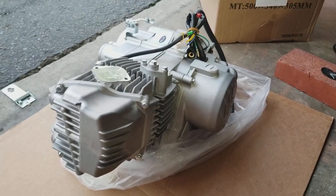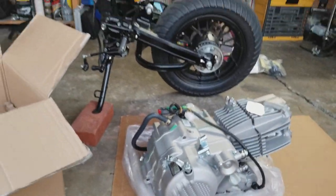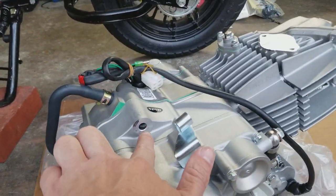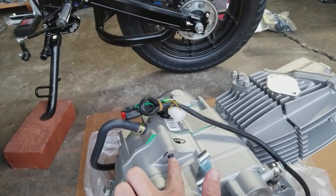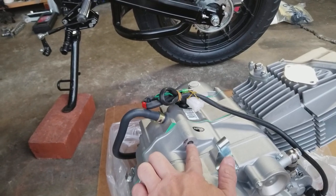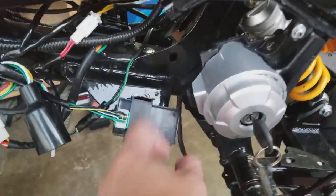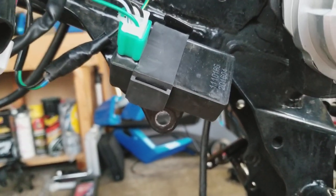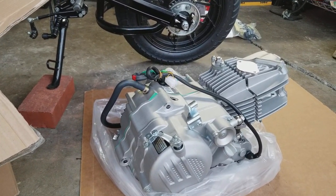It's like a little Daytona 190. That's it for now. I'll be posting some more videos - hopefully I get time. Maybe I can throw some clips of me putting it in the bike. You can see the engine bolts - small little M8 size, but it's a lot more beefy than a stock engine. What I may end up doing is drilling out this hole to an M10, so it's just going to be a much more secure bolt. The hole that I have here is actually larger than an M8 - it's actually as big as an M10. So I may go that route, I'm not sure yet. Hope you guys enjoyed it, I'll see you guys later.